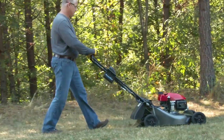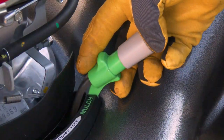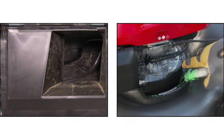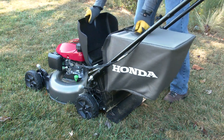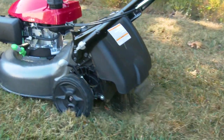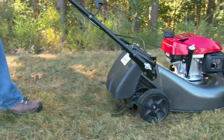The clip director can be adjusted to either the mulch or bag settings to achieve the desired mowing results. To adjust the clip director knob, stop the engine and pull the release lock toward you, then slide the knob left or right to your desired setting. The knob adjusts the sliding door from the bag position to the mulch position. To discharge the grass clippings, adjust the clip director knob to bag and then simply remove the grass bag and allow the discharge guard to return to the lawn mower deck. Using the discharge feature allows the clippings to exit directly behind the mower. Don't operate the lawn mower with the discharge guard in any position other than fully closed if the bag has been removed.